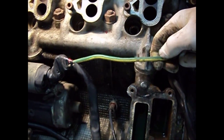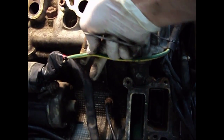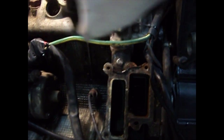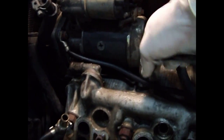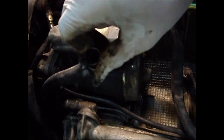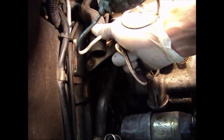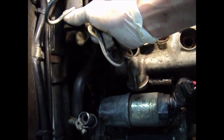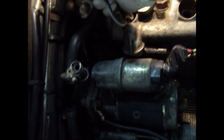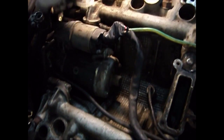There's also very obviously improper wiring — the type normally found in household appliances used in the earth or ground, unlike proper automotive ground wiring. The fuel pipes and water pipes are in very bad shape — some very hard, some very soft. The breather pipe within the oil and fuel system is hard as rock, and the water pipes also.